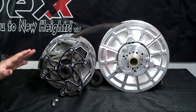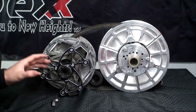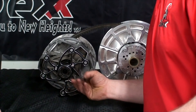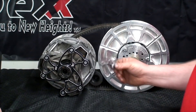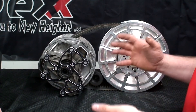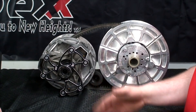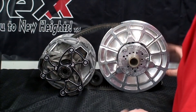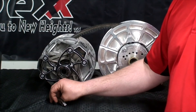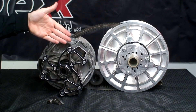So we're talking about the brains behind the secondary and primary clutch — but what if you only want to get a set of weights and not change the secondary clutch at all? Yes, you can, and IBEX offers kits that just use the primary weights. You can absolutely change performance just by changing the weights, same as just changing springs. But if you only do a piece of the puzzle and don't make sure the whole package is working together, you may make gains — but your gains will be small. The sum of all the parts provided as a package is greater than any of the individual pieces. Essentially, we've got the cookie and the icing, and together we get a frosted cookie.